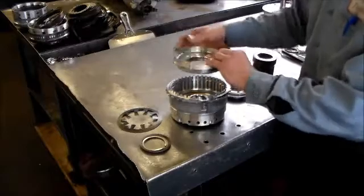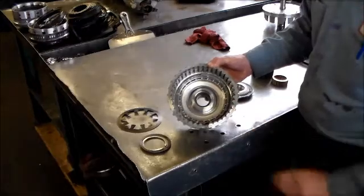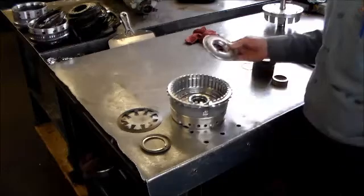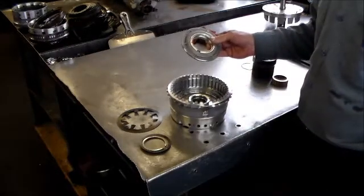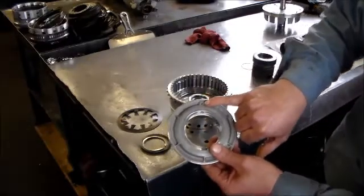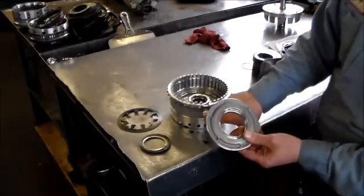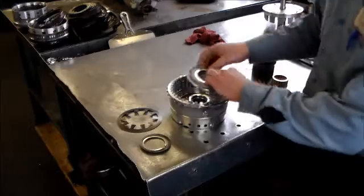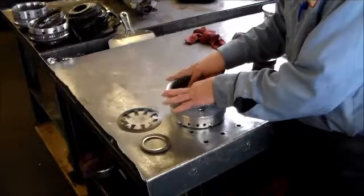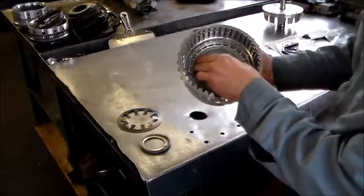So we have this at the 6 o'clock, and then we have our B2 piston. There is no special way this can go in, so it just drops right in like that. I'm leaving the O-rings off so it goes right together. Then after that we have your B2 piston guide, and this has that little bleed orifice right here, and it has to go at the 12 o'clock position, opposite the open gap. So this is going to go in just like this.